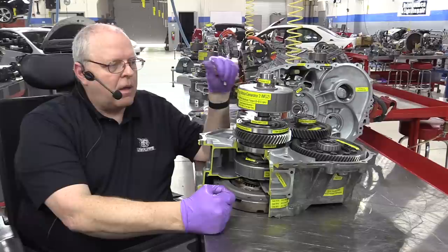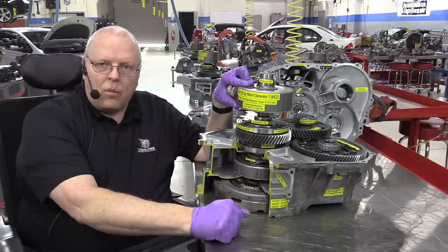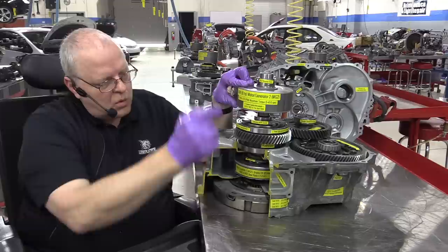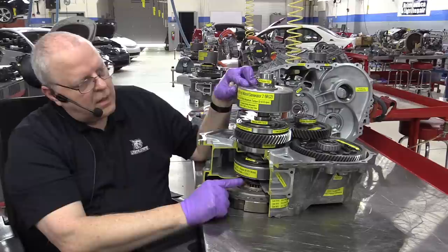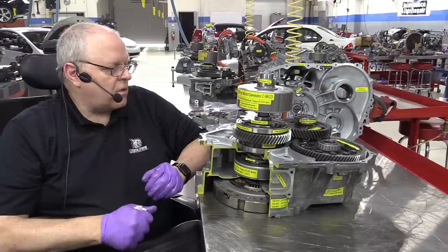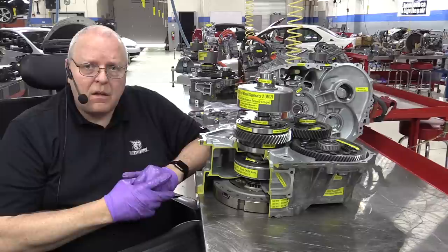The power rating, the torque rating of MG2 went down, but through the torque multiplication that takes place through gear reduction, we increased the torque over the previous design, and our horsepower rating is higher. We have an MG1 gear ratio to MG2 gear ratio of just a little over one turn, 1.014 turns. So as I turn MG2 one rotation, this will turn a little more than one rotation, 1.014 rotations. And once again, that would only occur in electric vehicle mode, like in the 2012 through 2015 plug-in Prius, the plug-in hybrid vehicle.